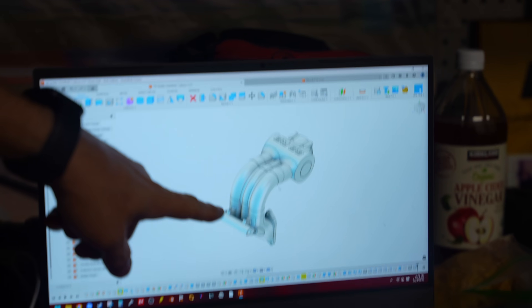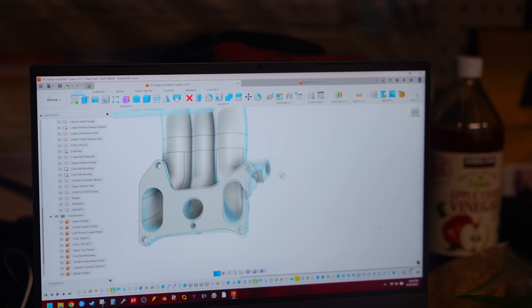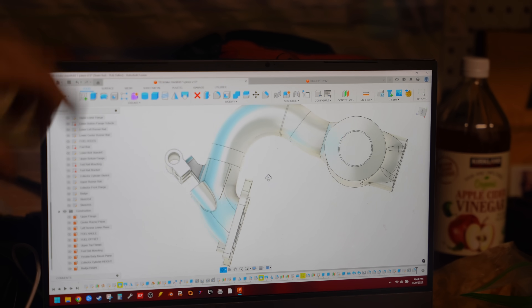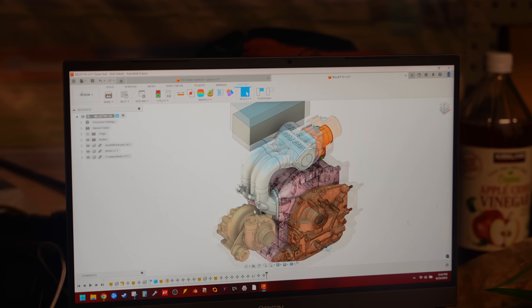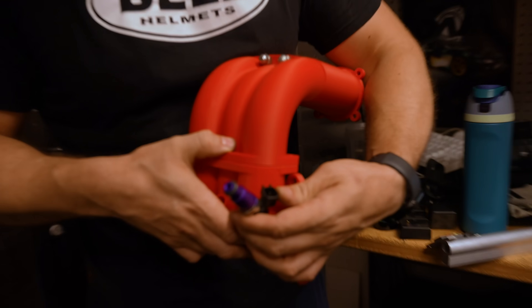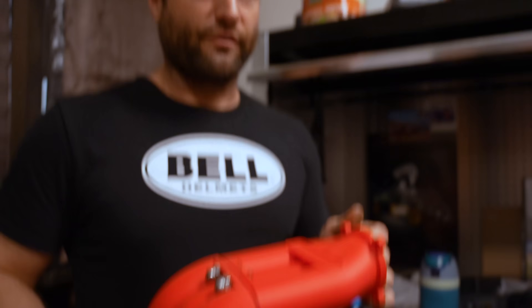There's the fuel rail — all the injectors shooting straight into the engine, almost as direct as humanly possible. The rail sits far enough away from the turbo with plenty of heat shielding and air shielding. This is not a pipe-speed car, so I'm not even worried about that at all. We moved the injectors out so the connectors can sit up further away, meaning more heat shielding between the two. Very pleased — we're going to make it look pretty damn cool. We're just on a warpath to getting all the projects fired up at once.